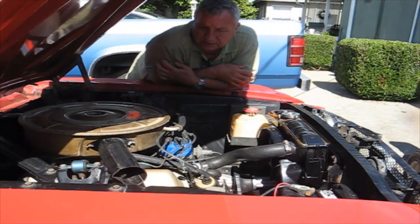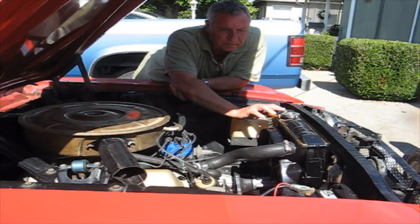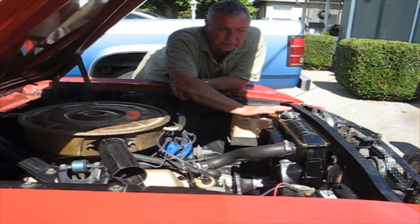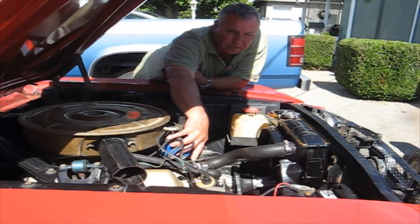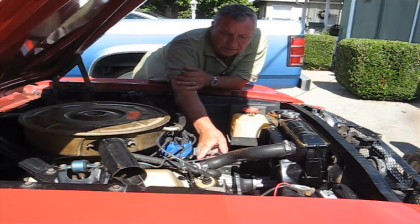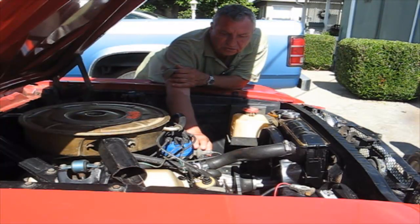So you got to remember, I started with the radiator. People I got the car from said the radiator leaked. I don't know if it did or not, but it was a brand new radiator, so I put it in. Okay, because it was leaking water, and I couldn't figure out where it was leaking water. Well, the next problem was the thermostat. I changed the thermostat, a lower temperature thermostat, and it was okay, but I had the old housing, and the old housing didn't have a notch for the thermostat itself. So I put 2 gaskets on there after they're dry, and it still had a slow, low leak.